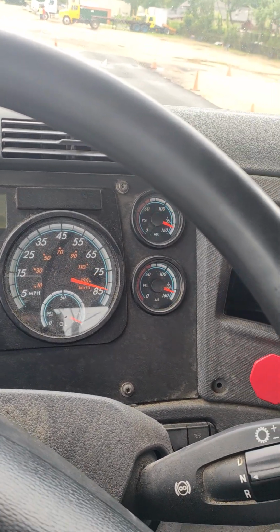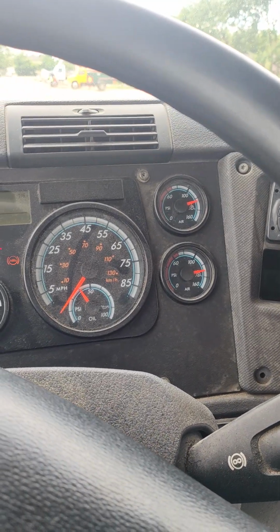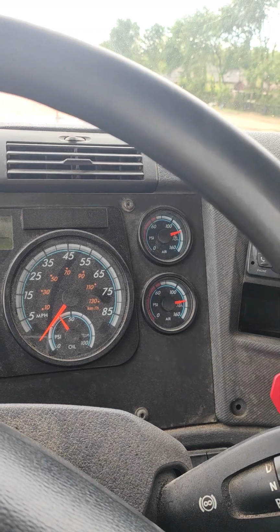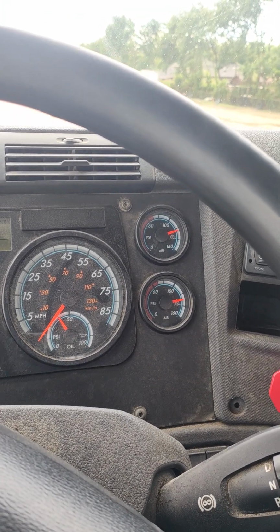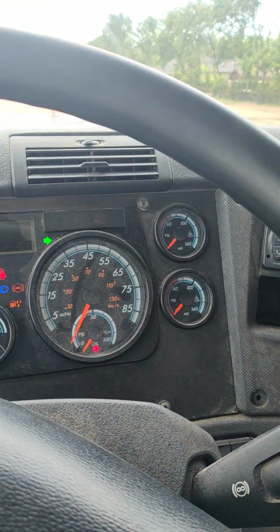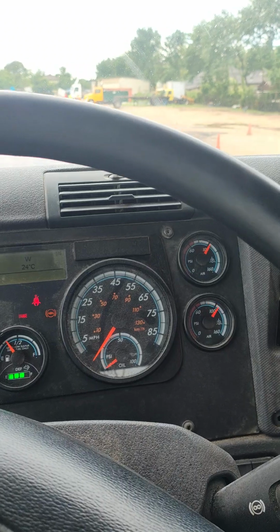As soon as your ABS light cuts off, we'll go ahead and turn the vehicle on. And we're going to focus on our secondary and primary air tanks. At this point, we can tell the tester that we are ready to begin our air leak test. So now we go ahead and turn the truck off. Turn it back to the on position. Once my gauge is finished and they settle, I'm going to start with my air leak test.